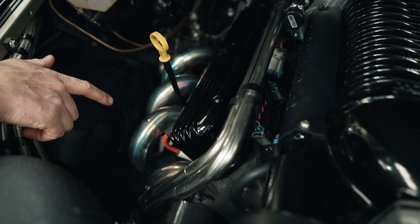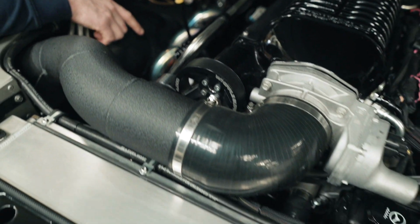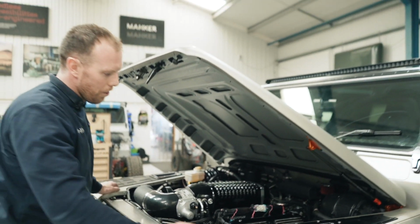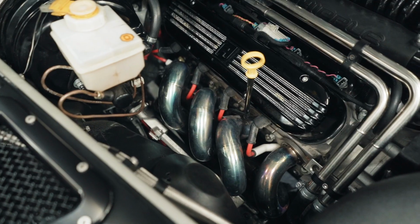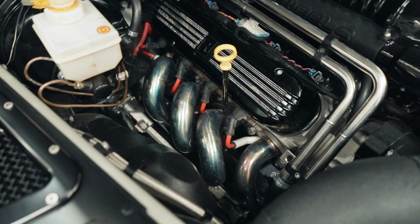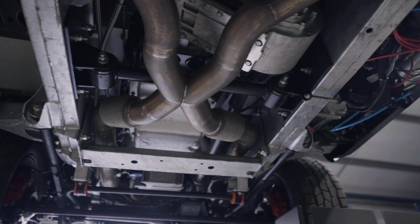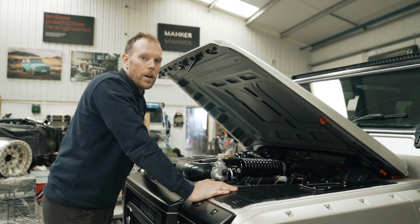So we gave these cars these 2-inch headers, and these are just beautiful. As you can see, the heat from the exhaust has turned these a beautiful golden blue colour. We've gone down from a 2-inch header into a 3.5-inch secondary. The secondaries then go into an X-pipe. The X-pipes then go into our silencers where we've got the valves.